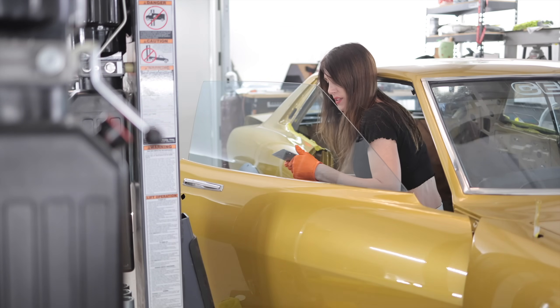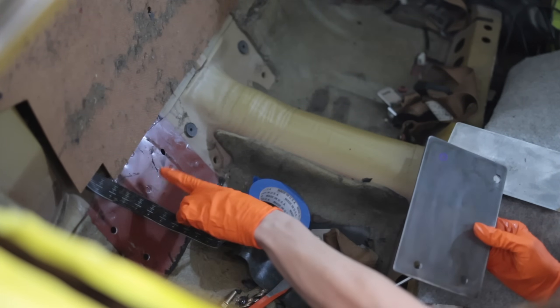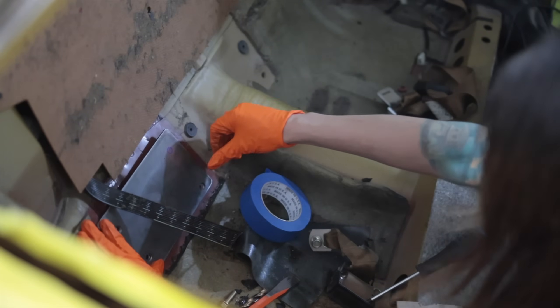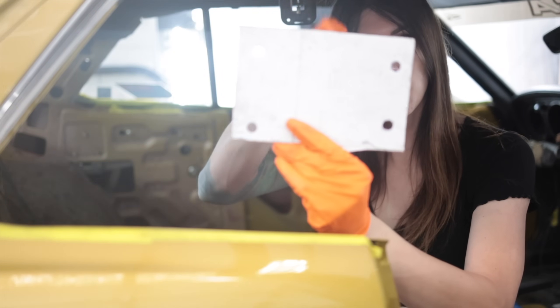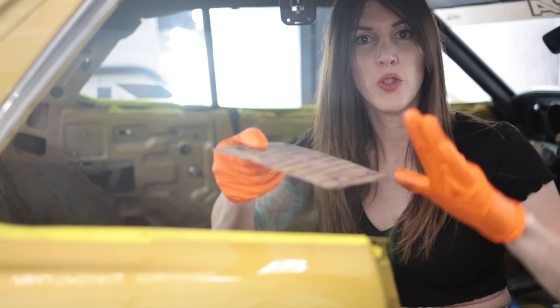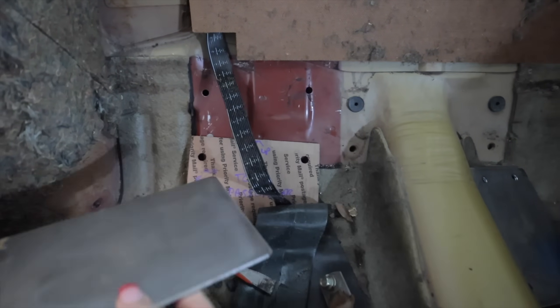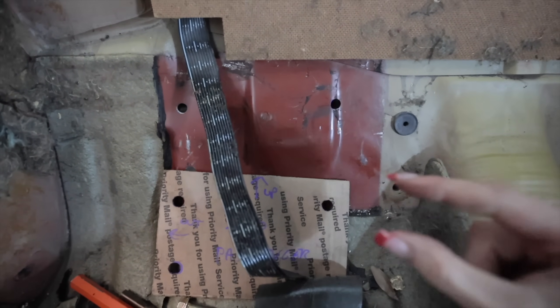I have good news and bad news. Because this hump is right here from where the upper link mounts to the car, you cannot bash that in — that poses an issue with this fitting tight against the car, which it absolutely has to for this to be effective. So what that means is this plate has to get split in the center and bent up, so that way it's nice and flat and sandwiches that chassis. If there's any gap whatsoever, when the forces of that link are pulling on it, you're just going to squish that gap and it won't be effective — it has to be perfectly tight.